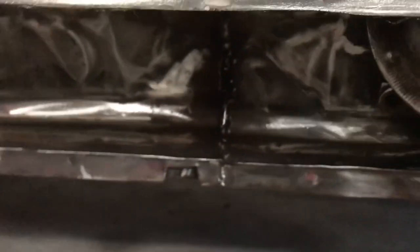Yesterday I was talking about having to unpick all those spot welds. Because the bottom of the inner sill is rusty, I'm just going to cut the bottom of it off. That'll get rid of having to undo all those spot welds anyway, because it'll all be taken off with one chop of the grinder. So that's what I'm going to do now.